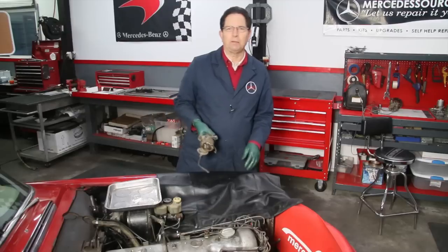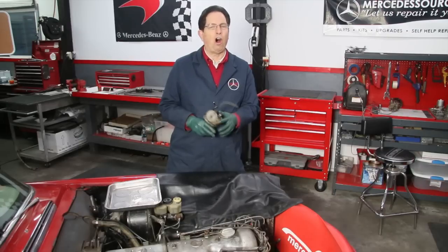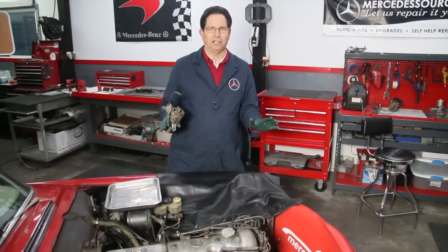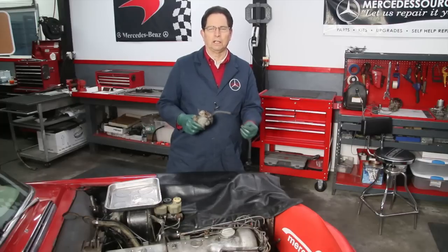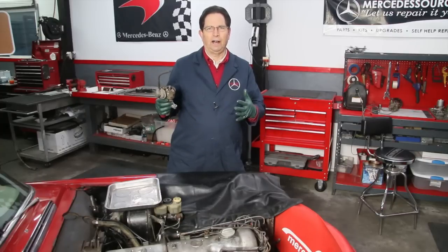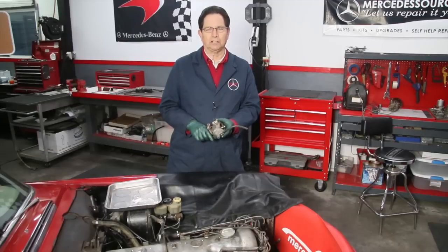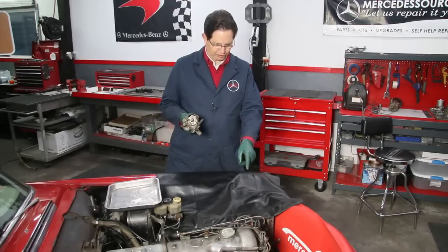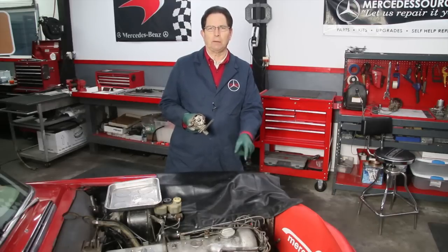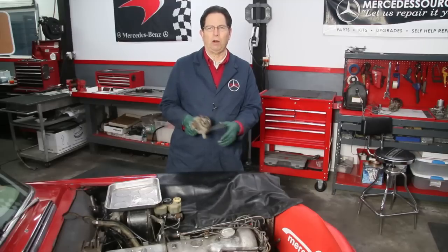This isn't going to be a complete video on rebuilding distributors, but I'm going to give you a couple options. I've converted all my older gasoline Mercedes, pre-1972, to electronic ignition. Now, some of you purists will say that's not original — you have to decide whether you want original or whether you want performance. The systems I install do not harm the car and they can be converted right back to the original point condenser system quite quickly. We'll open up Happier's distributor here and just take a look at it.